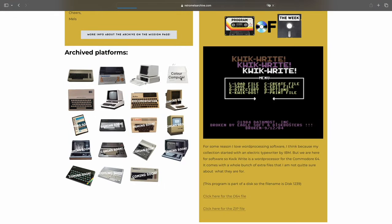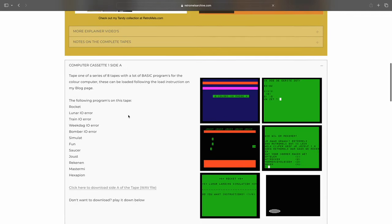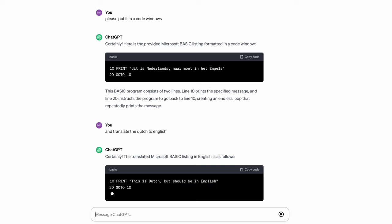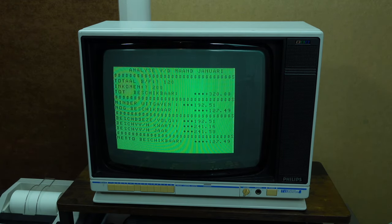I moved on to a different tape — IO error again. It is so interesting that when you try tape files they work, and then later they don't. But tweaking your settings will most of the time fix these issues. Old computers can be hard to please. Remember that when downloading files from my archive — these are really for people that just want to tinker a bit. Also take into account that a lot of these files are in Dutch or a mixture of English and Dutch. I want to see if I can use an AI tool and emulators to translate the Dutch basic code to English, but only if I find an efficient way to get the basic code off the tapes. But then finally the computer returned an OK, and we can type RUN. Sadly this is not an exciting program — it's called Budget and it lets you make a sort of budget in Dutch. But loading is good I guess.